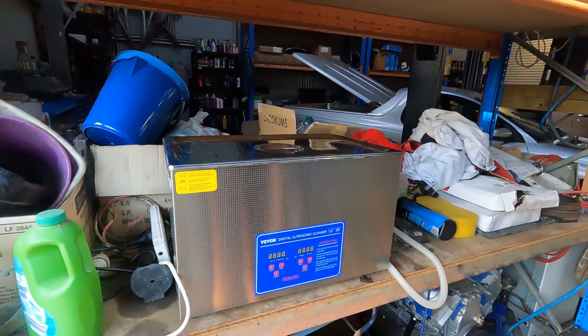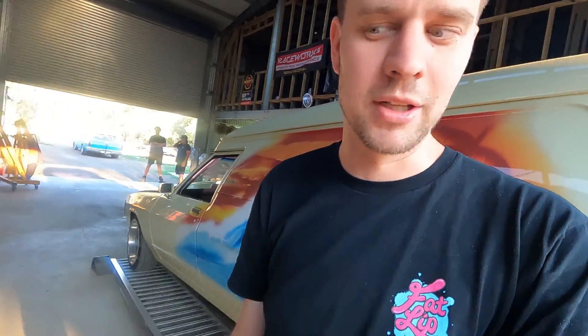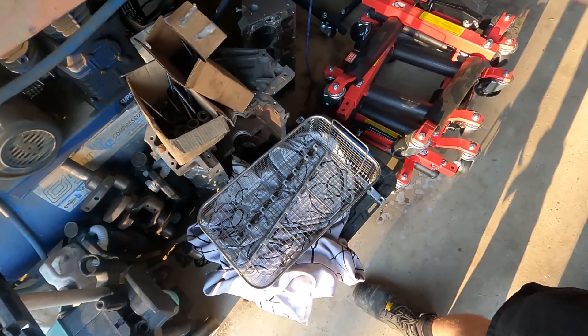After another 10 minutes and a blast off, look how much better they are. I reckon another 10–20 minutes and they'll probably be just about sorted — which I will do — but I've run out of time today. In a nutshell, this 30-litre sonic cleaner is a really handy tool. We're stoked with it. I'll keep playing around with solutions to find something we can leave alloy in without worrying about etching, but the setup works awesome and heats the solution pretty quickly.